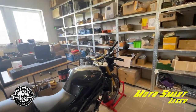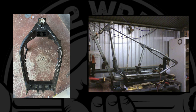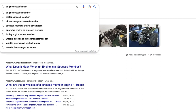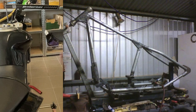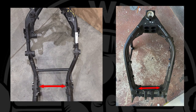It's hard in a 10-minute video to make you an expert on every possible scenario when inspecting frames. One point I want to make is: when we talked about checking a frame on the bench without the motor or fully assembled motorcycle, keep in mind some frames are a stress member. So if you're buying a frame from a custom welder or picking one up on eBay, I'd recommend putting spacers and a bolt through the swingarm mounting point and torquing it to spec to add that stress. The challenge is knowing how much the frame is supposed to flex, so some of that will be trial and error.